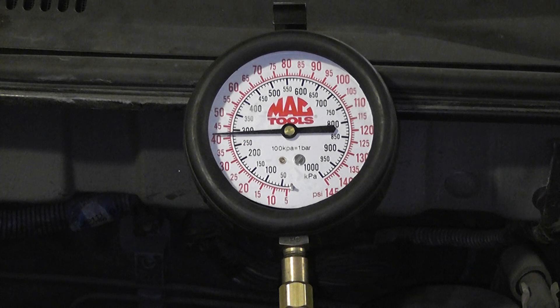For this next step, this is really important — you want to make sure that fuel pressure holds and you also want to know what your fuel pressure is at. Go ahead and turn that pump on. We're using scan tool bi-directional controls here. We're at about 47 PSI operating pressure. This is a returnless system; the fuel pressure regulator is in the tank, and the fuel pump is in the tank obviously.